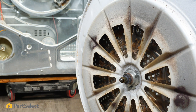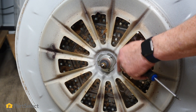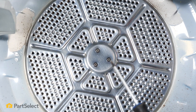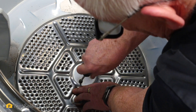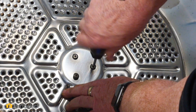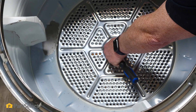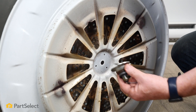To replace the bearing we need to remove the three screws that are holding it in place, going from the inside of the drum. These are Torx T20s — just unthread them and take them right out. With the screws removed you can pull that bracket right off.